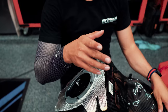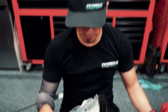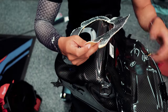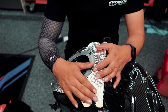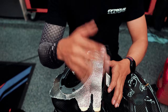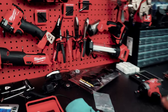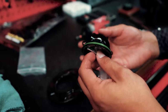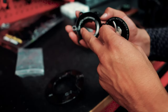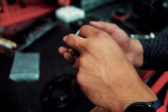We took out the pump from the original tank and installed it on the carbon tank. We checked the box and checked for the heat shield, so we're going to put the provided heat shield onto the carbon tank just like OEM. Looks like TWM has a patented bracket on this one.